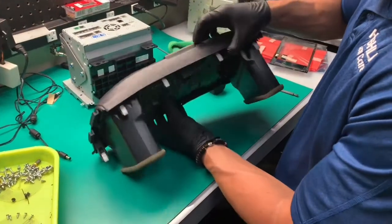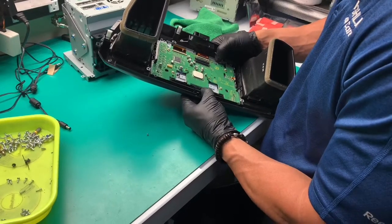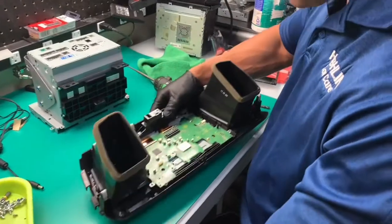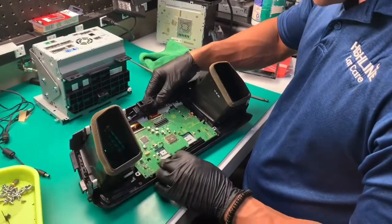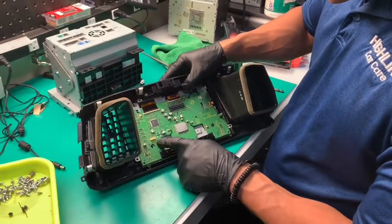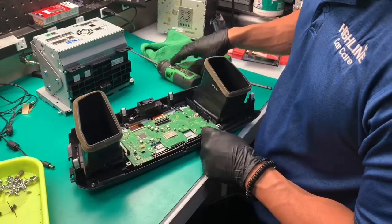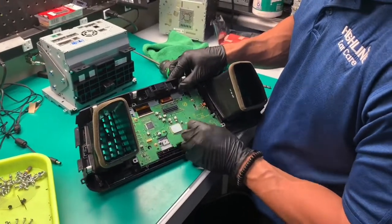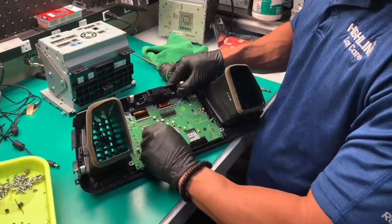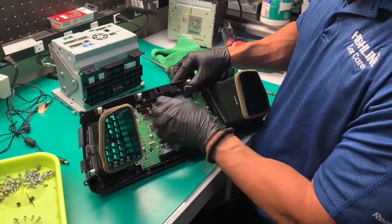Let's go ahead and dig deeper. Looks like we're still hanging on, so let's take some more screws off. Let's go ahead and take these four Phillips head screws off. This is going to remove the circuit board it looks like, so I'm going to go ahead and flip these two cables off, and this ribbon cable, and this ribbon cable.